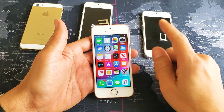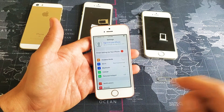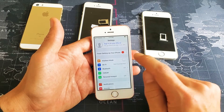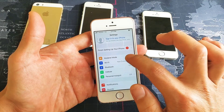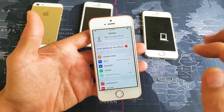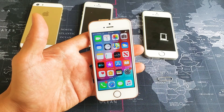For this next step, go into Settings and you'll see Airplane Mode. Turn Airplane Mode on, wait a few seconds, then turn it off. Turn it back on, then turn it off again, and now wait a minute — hopefully it finds your network. If not, we're going to go to the next step.